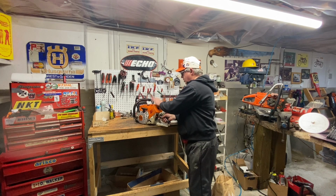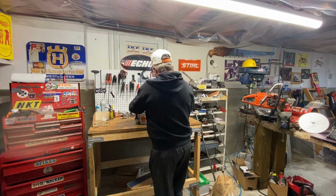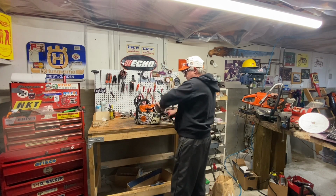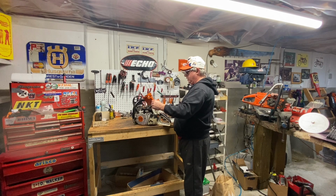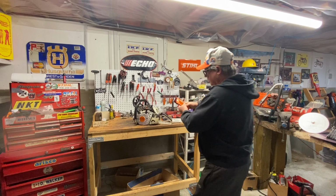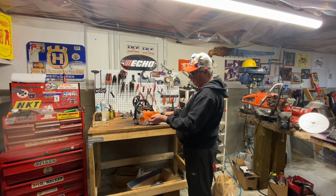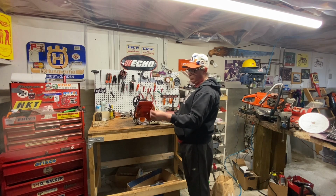I've done that. I'm going to change this top cover. I think I've showed you guys before on these 500s. I'm going to put a Max Flow muffler on this, so that's why I'm taking this off right now. Boom. Get rid of this. I'm putting the Max Flow on, and Matt has some foam filter oil from his dirt bikes to put on there. This cover here, if you notice already, is missing 2 of the 3 pegs where it sits in these steel grommets and rubbers and moves around. They didn't really engineer this quite right. This thing should have snapped down harder so it doesn't move around. As it moves around, these little things break and it gets all wobbly, so you go through a lot of these covers.